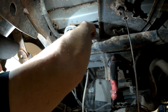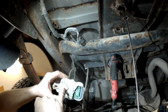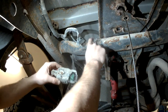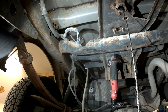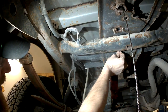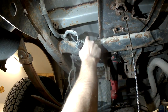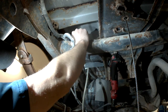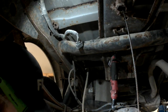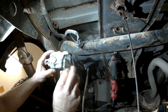Gently try and remove what's left of it. As you can see, it corroded completely through. They get dirt packed in here — this is more prevalent in areas where they use a lot of road salt or where there are gravel roads. The dirt, grime, and road salt get up between the frame and the module and just eat them up. You can see how stuck down that was. It's aluminum — the aluminum back is just gone.